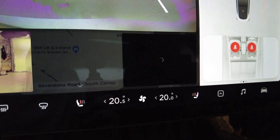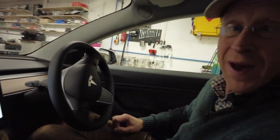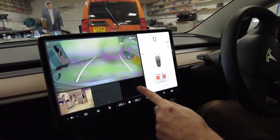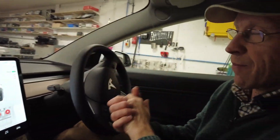Pins look fine. Let's make sure both are plugged back in, rest it there, go inside, select reverse, and see if it's working. Let's push up into reverse and have a look. That camera looks totally dead. If I were doing a full investigation, I could check the voltage on the power connector pins and also try swapping the left camera cable to the right. But I'm happy to let Tesla take a look at that.